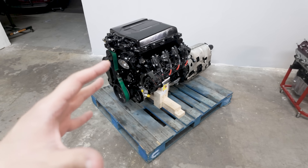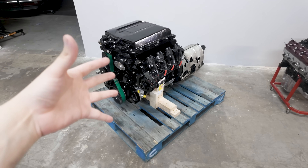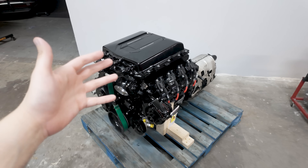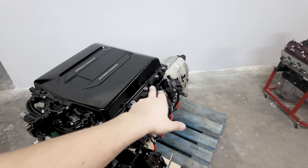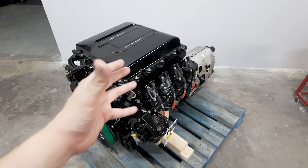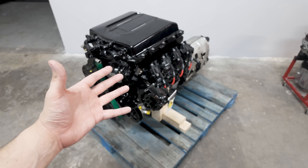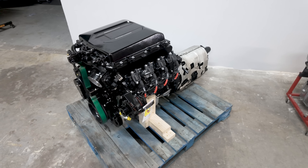This is essentially our version of the LT5 — that's what it is. The blower is basically identical. The only difference is the LT5 had a different lid that said Corvette on it and had port injection. If you didn't know, the only reason they used port injection on the LT5 was to keep the cats happy, so unless you got into the performance aspect of it, you weren't really using the port injectors at all.